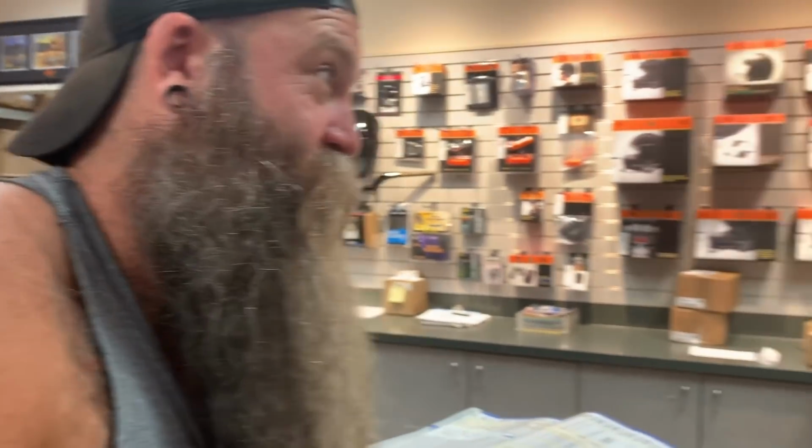Yeah, and I'm not a mechanic. I'm not afraid to. I'm learning so much. This right here is pretty exciting. Well, some of this stuff's pretty tough. Like, this can't go on without lifting the tank. So the tank has to be unhooked. You got to lift the tank. It's all doable. And it is a tight fit, so the guys use bit drivers to get into it. You can't get a socket and ratchet in there to actually undo your intake.